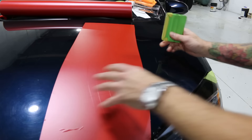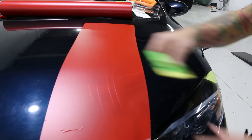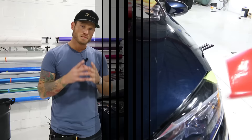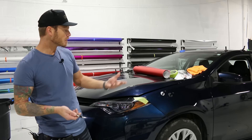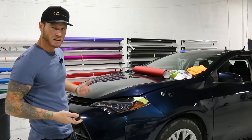I got the whole piece down — just to show you the difference between squeegeeing firmly and squeegeeing too light. Now let's run the heat gun over it and see if we actually left any air behind. No tiny air bubbles at all — nothing in the middle here. Now, you don't want to go too quickly or use the corner of the squeegee, because look what happens: that is a friction mark in a matte film. You can make these all day long — that's basically a bonus mistake number six. Try not to press with the corner of the squeegee — put your thumb in the middle and maintain good pressure.